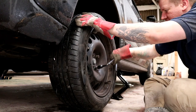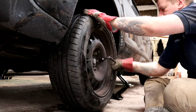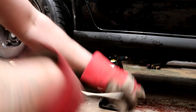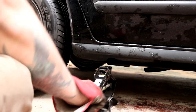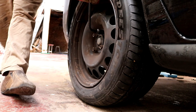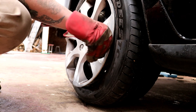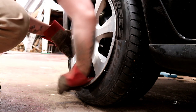The last thing you want is to be overtaken by your own wheel! Whip the jack out — this is really when you tighten the wheel nuts, when it's on the deck; you don't want to be doing it when it's in the air. There you go — you can see some pressure on the bad boys. Tighten them up. Hub cap back on — or wheel trim, whatever you want to call it — use the side of your hand, not your knuckles. It hurts.